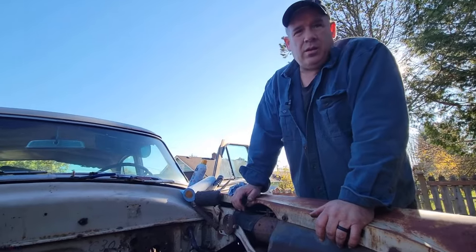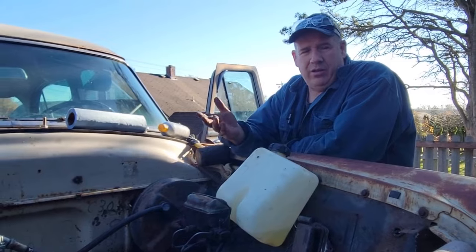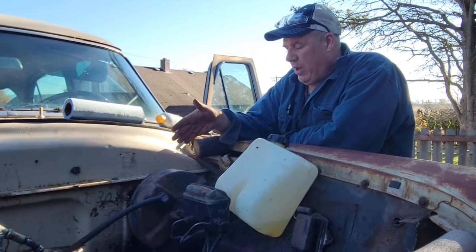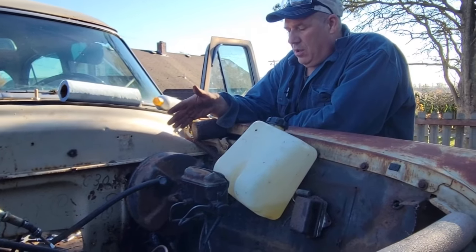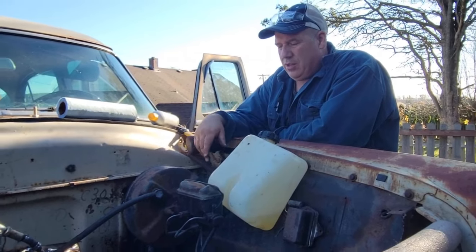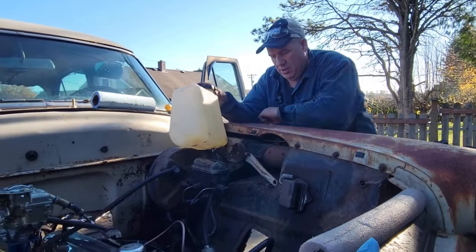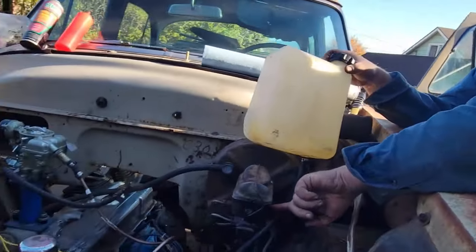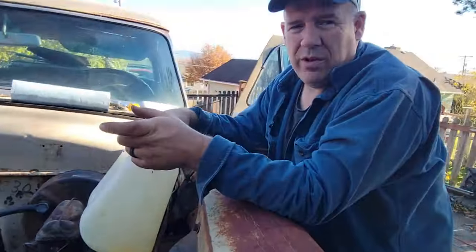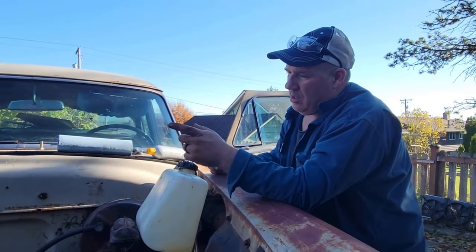All right. Stop the video. Let's come up with something. Okay, so off camera, I couldn't do it. Mariana and myself had to do it. We couldn't push that thing in. Finally, we hooked it back to the pedal to push on with the leverage. I know I have 1 inch of pedal movement is all this thing has. I'm sure this is going to take more, probably 2 or 3 inches to get full movement. This thing had a real small original master cylinder. So I don't think I have everything I need to make this work.